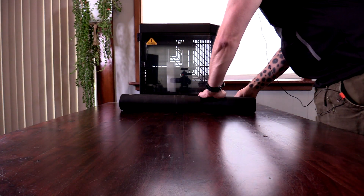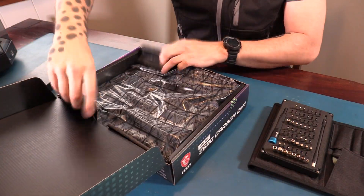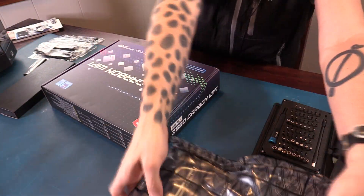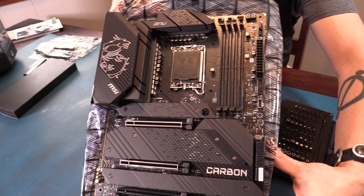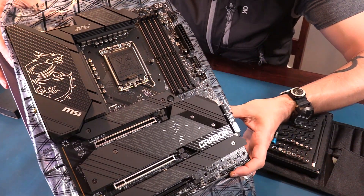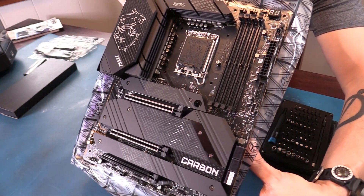As I set things up, I'm going to share each step of the build and talk about the components I picked and why. First up, let's prepare the motherboard. I went with the MSI Z690 Carbon — it's an LGA 1700 ATX board. I really liked the look of the design and wanted it to match my GPU. Utility-wise, it has all the additional USB ports I need for my audio and recording equipment, and it has excellent transfer rates.